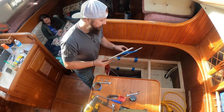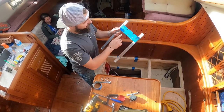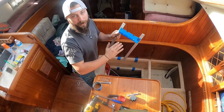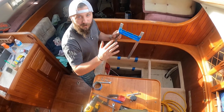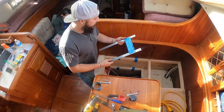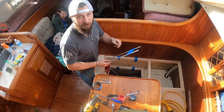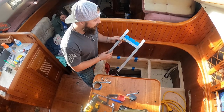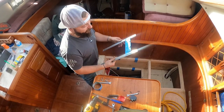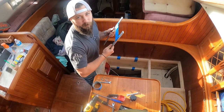So last night I went to install my little makeshift bracket, and when I put it on I didn't have these screws mounted and it was actually flexing and giving me a rattle. I always put stuff on top and shake it because anytime on a boat underway, things are going to rattle. So we got a rattle with the original brackets - called it a night, went home, and actually added this cross brace and welded it in real quick. Since I was in the shop, I countersunk the screw holes to make it look a little nicer, and it's a lot more robust now.